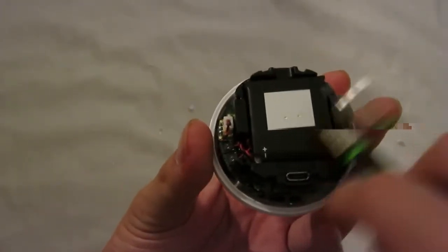Back to the last screws. I have to use one of these small flat head screwdrivers to unscrew it because the tip is too large otherwise. And the whole board just lifts out. I need to remove these connectors — this one for the microphones and this one for the speakers — and I'll just leave this aside.